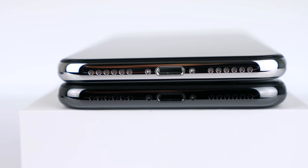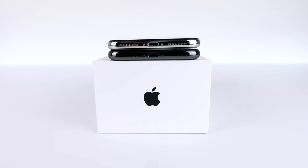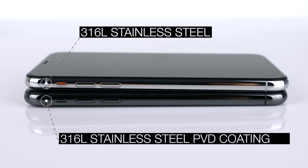The stainless steel frame is another very big difference between the two. On the silver iPhone X, the frame is made out of 316L polished stainless steel. On the space gray iPhone X, we still get polished stainless steel but it's given a coating to make it look black or dark gray. From what I found, this is not diamond-like carbon coating like on the space black Apple Watch — instead it uses PVD coating, which is a vapor coating process that applies a fairly thin layer. The coating on the Apple Watch is more like a protective paint and is therefore more durable than the PVD coating on the iPhone X.